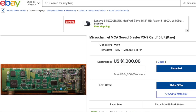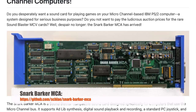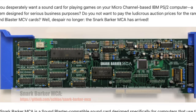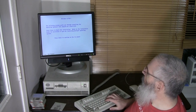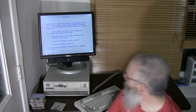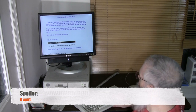It is much more difficult to find Micro Channel cards for PS/2s, especially for things like sound cards, than it is to find their equivalent ISA cards — so that is a negative. However, we are starting to see some homebrew development of Micro Channel cards. Recently, a Micro Channel sound card was just released called the Snark Barker MCA, which is a clone of the Sound Blaster MCA. Both the Sound Blaster and the Pro Audio Spectrum had Micro Channel versions sold back in the day, but not a ton were sold, and correspondingly they're pretty rare and sell for a lot of money nowadays.